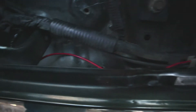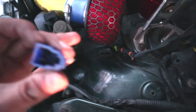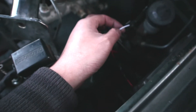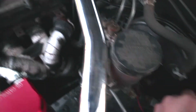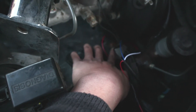Everything's wired up. The red wire is the power wire — I extended that and it goes all the way under the fender to this cable that comes OEM with a plug for accessories like fog lights, so I just spliced into that for power. The white wire is the output cable, which I spliced into the OEM connector right here so the signal wire goes through the stock connector into the harness. All the other wires are just taped off. And lastly the black ground wire is grounded to the ground point right there.